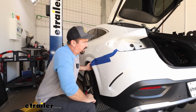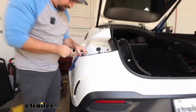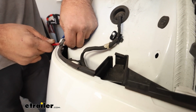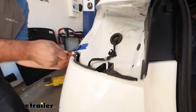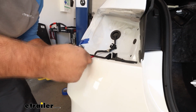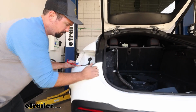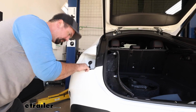Once you get to the taillight section, this plastic portion, there are tabs that snap into there. They're pretty tight. What you can do is wedge that trim panel tool or a flat edge here, and on that black, try to push down and then keep pressure on the fascia so you can slide that tab out. It should make it easier for the other ones as you go along, but the main thing is keeping that pressure so it doesn't snap back in. And once you get towards the inside, you can pull on this one as well. So we just have this holding here.